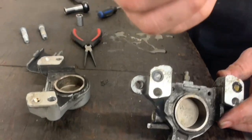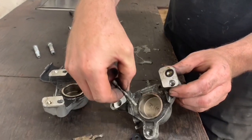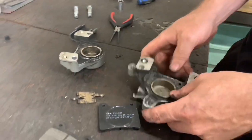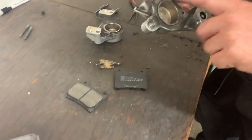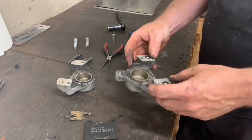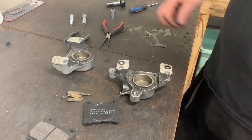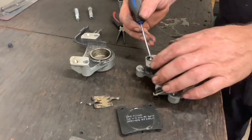Brakes in, so we'll wire wheel them up nice and clean, and we'll clean all in here where the pad rides. Once I pop these cylinders out, you'll see underneath these rubbers I'm going to take out, the fluid gets behind them and turns into a white crystallized powder kind of stuff, and that's what sticks the O-ring. Actually brings these back in when you let off the brakes.